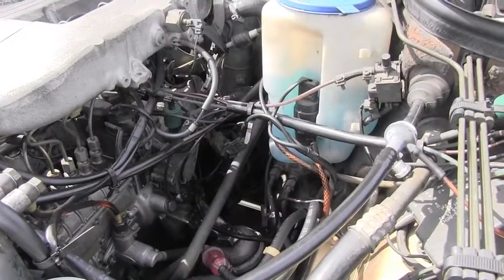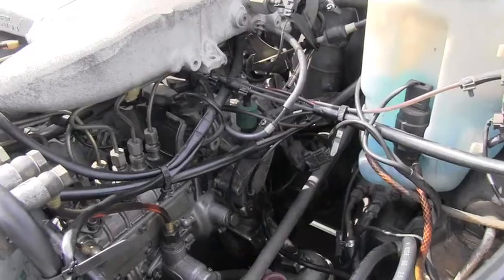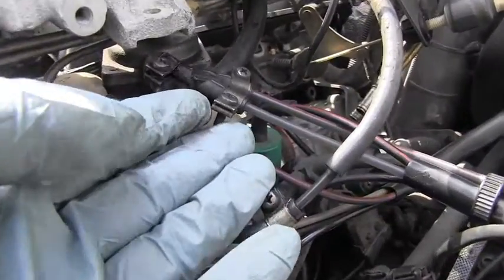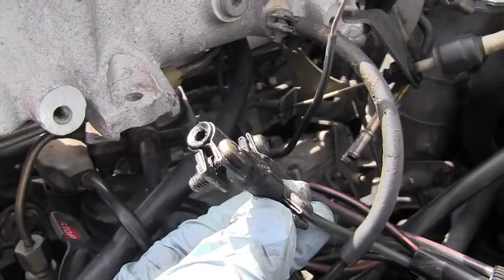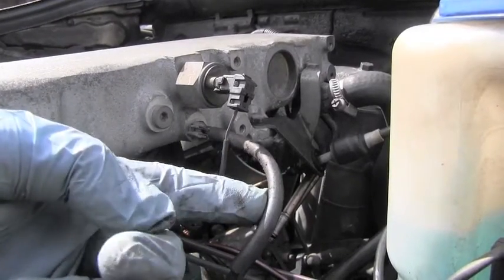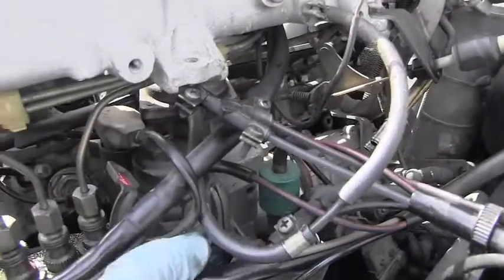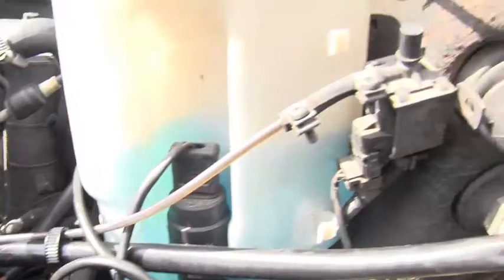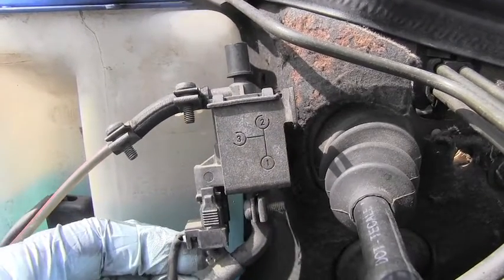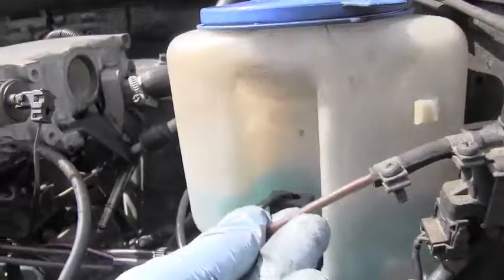But let's move on. Looking at the whole system quickly doesn't tell you much. It's only after a while, when you examine the details, that you start seeing the problems. For example, here — do you see this fitting? It's not connected to anything. Looking up here, whoever is familiar with these diesels can immediately see that this hose is supposed to continue to the switchover valve, but somebody hooked it directly to the ALDA. This switchover valve is called Y30 and it's for engine overload protection — as you can see, it's disconnected, just hanging there, and this is not going anywhere.